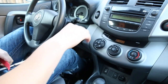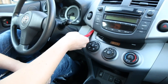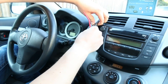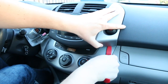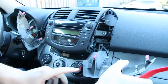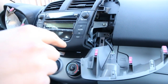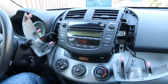Our main goal is to remove the radio to plug in our kit. First we're going to use our panel removal tool and remove these two side pieces inside of the radio — just get underneath and pop them off. They're just held on clips, so don't worry about breaking anything. Over here you're going to see there's two bolts on each side and also a Phillips screw, same on this side — two bolts and one screw. We're going to go ahead and remove these right now.